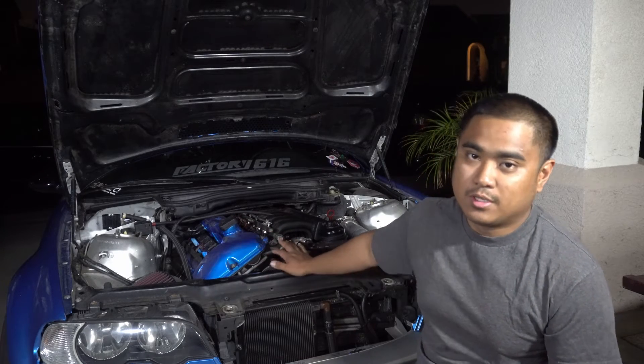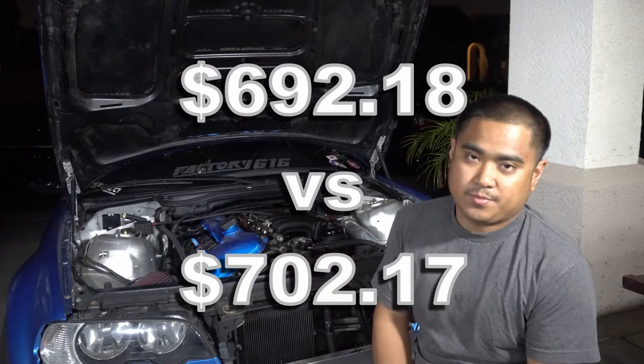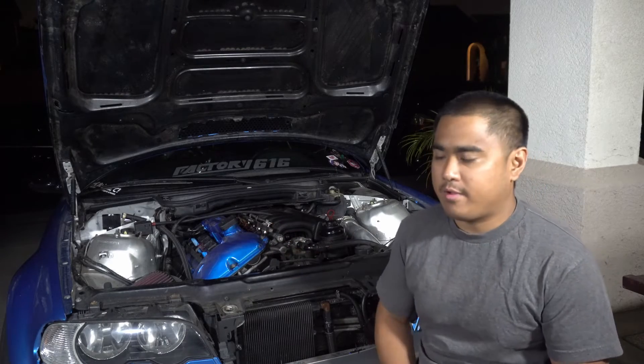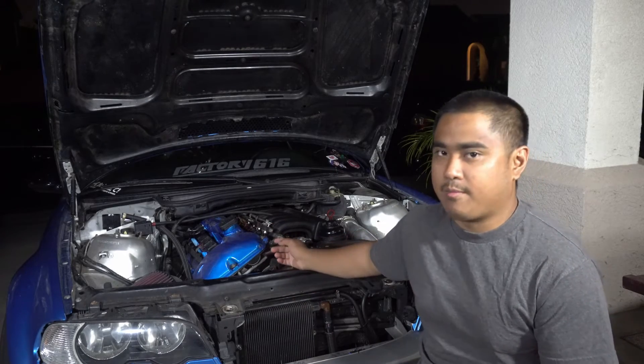For electronics, the bare bones isn't much different than my actual setup at $692 compared to $702. That's because I left out the serial connector I originally tried to use for the wideband, which didn't work out anyway — I had better luck just hardwiring the gauge to one of the post-cat O2 sensor plugs.